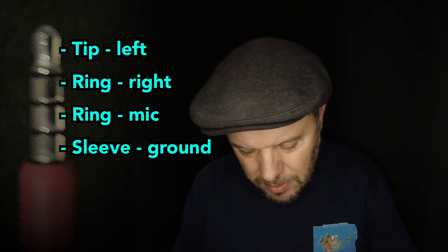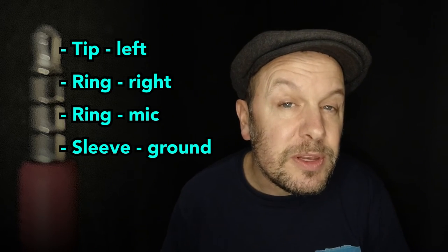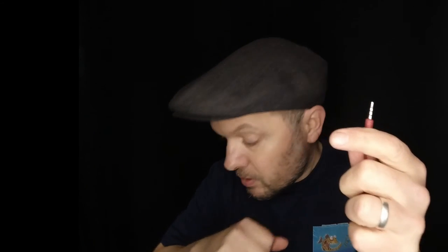It's not really of any professional use. The trouble is — and I've made a video about this — if you're using a pair of headphones with your iOS device, by default it will use the microphone built into the headphone cable. To stop that you need a pair of headphones that only has two bands. You can make a cable with a female stereo socket so you can still use your headphones with that sort of thing, and I've described that in another video linked below.